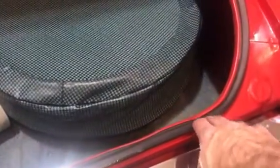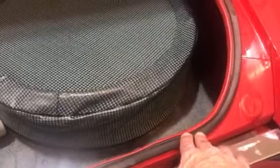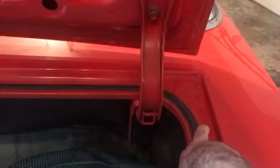But also you look at really, inside the trunk wheel lip, it's very nice. Right here is a common rust area where this would rust. You can see this spot weld here. This here is also a spot weld here. The date code, which is the month and day of the year, coincides with the build date of this car, so it would be indicative that at least these quarter panels are original to the car.